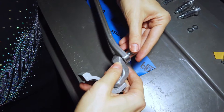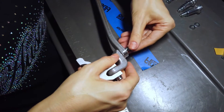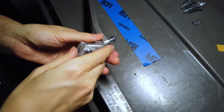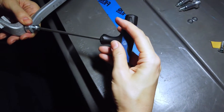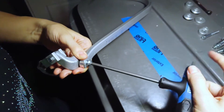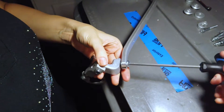Find the correct handguard bar for the side you are working on. The bar's grip end should look up when you lay it on a flat surface in the correct orientation. Take the round head bolt and use it to attach the inside of the bar to the connector. Again, don't tighten it. The whole assembly should be able to rotate around its connection points while you install it on the bike.